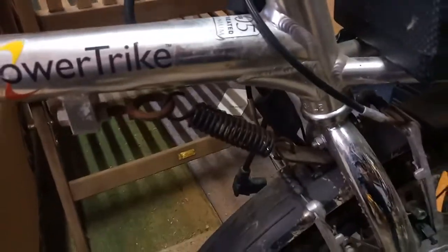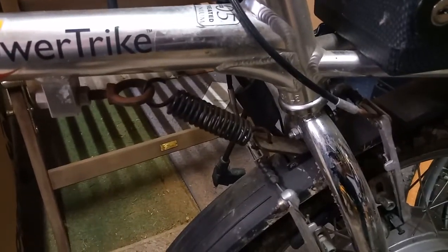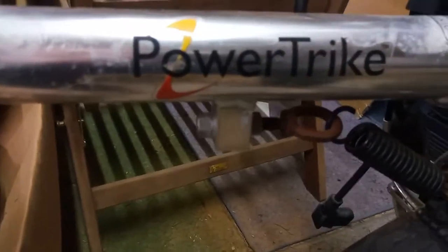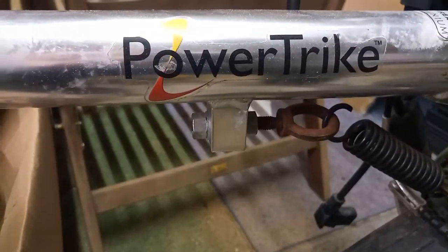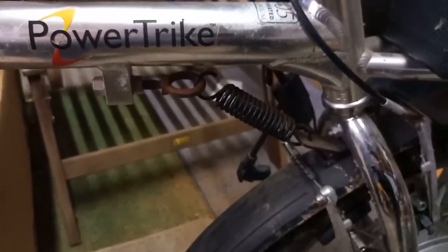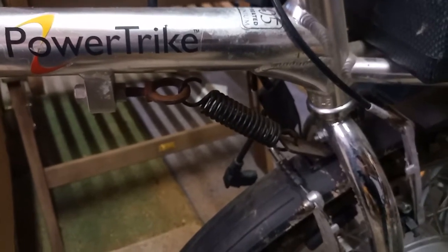Next along the line, we have this spring here. What this spring does is it keeps the front wheel in a straight line, and when you're turning, it provides resistance. There is an adjuster so you can adjust the amount of resistance being applied, but that is a necessary piece. If the front end is light, then you could get yourselves in all sorts of trouble very quickly.